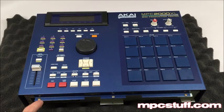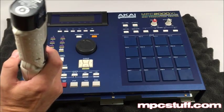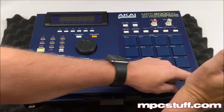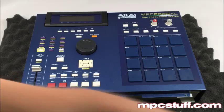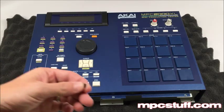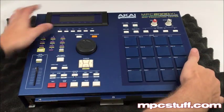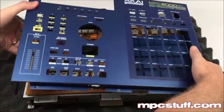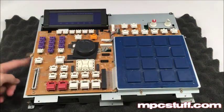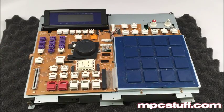Now we've turned the unit back over. You're going to see these three right here since we've pulled that front panel off — these are going to be the ones that will pull the rest of the casing out. Now we're going to pull our slider off here. There may or may not be a little spacer that you might need to pull out as well. Pull that off and put those aside. Now you're going to lift, push this up, and then pull up. You'll see there are little tabs on each side that might get bent around a little bit — just push them back, it's not a big deal. Now that we have our casing off, we're going to have a little more access to get our LCD screen out.